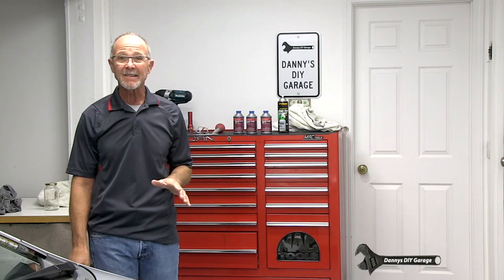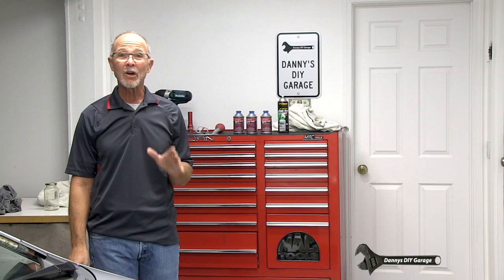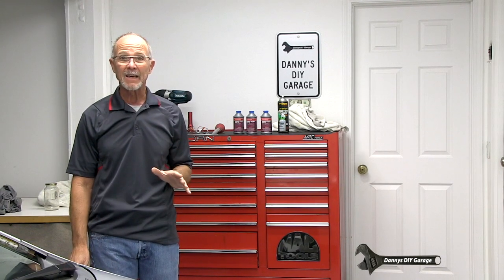In today's video, I'll be flushing the brake system on my 2009 Honda Civic. Brake fluid absorbs moisture, and if it's left in the system, it causes corrosion, and that'll damage your brake parts, especially your expensive ABS unit. Flushing your system just makes sense, and it's recommended every 2 years or 30,000 miles.